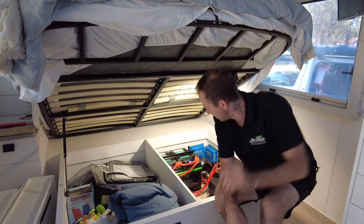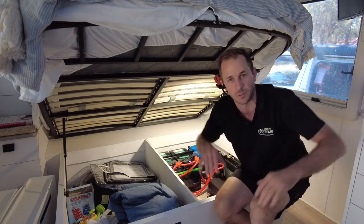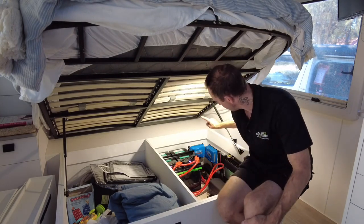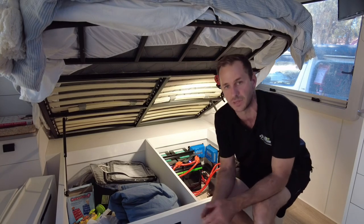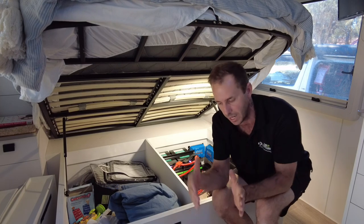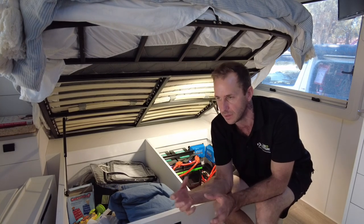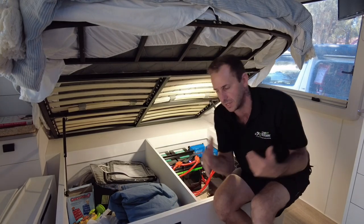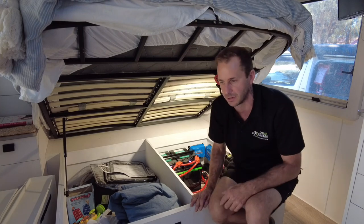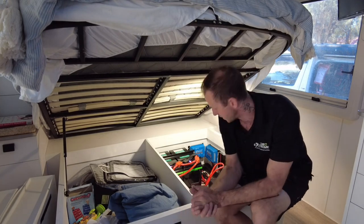Now, we've got a 50 amp Victron SmartSolar controller taking care of about a 600 watt array on the roof, running a high voltage string in zero shade, like you're in the open. Really happy with that setup. And we've got the 30-100 here, that's taking care of the customer's original two 180 watt panels, and we've just rewired them. Now, they're in a lot of shade, right next to the air conditioner. We've brought them away from the AC a fair bit to allow for better sun earlier in the morning and late in the arvo, but we've done the best we can. We'll see what he gets out of that.